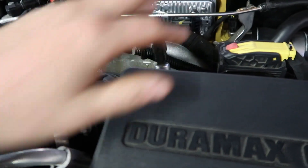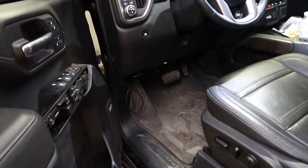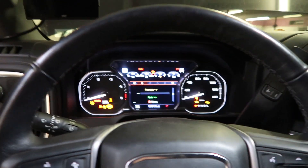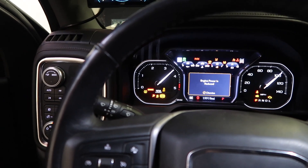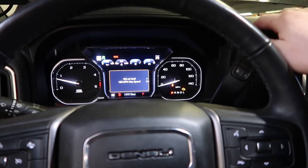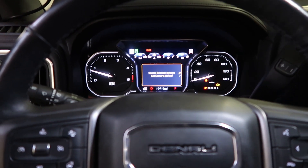What I'm going to do now is get this unplugged, clean it out, spray some electrical cleaner in there, and make sure everything on the CAN bus circuit is good before we reset. I'll unplug the batteries, get that clean, then hop in the truck and try to get these vanes reset. My turbo vanes aren't working the way they should — when I start the truck it sounds like a fixed vane setup. I'm going to start it for you guys real quick to recap. As you can hear, it comes up with engine power reduced and the service emission systems message on the dash with the check engine light.